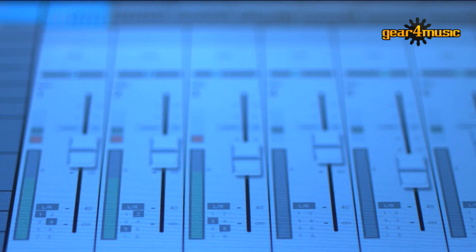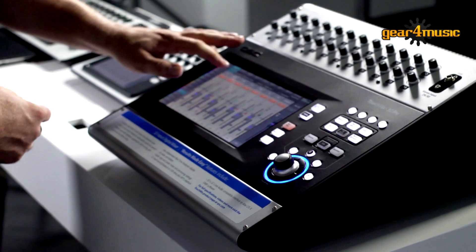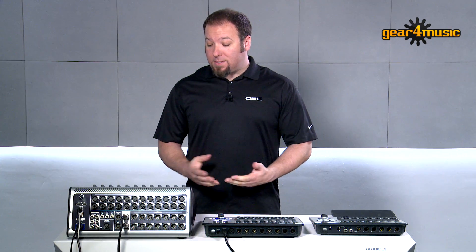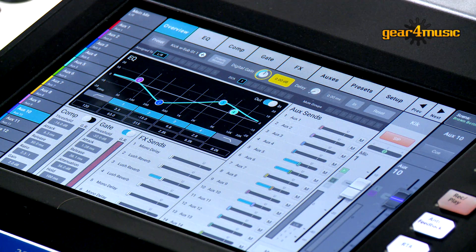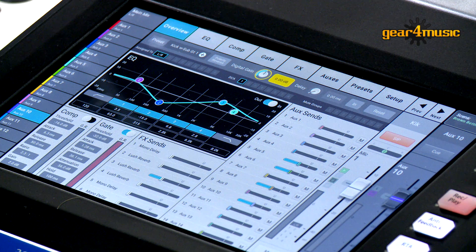The larger screen on the TouchMix 30 Pro gives us access to features that weren't previously available on the TouchMix 8 and 16. With the press of a button, I can get into the channel overview screen. This new screen gives me the ability to see my EQ, compressor, gate, effects sends, and aux sends all from one screen without having to jump around from tab to tab — so navigation is a lot easier. It also has expanded digital gain of plus or minus 15 dB added to our analog gain. This gives you the ability to save your gain settings in a preset or scene, so when you recall your scene the next time, you won't have to reset your analog trims — the digital gain adjustment is recallable every time.